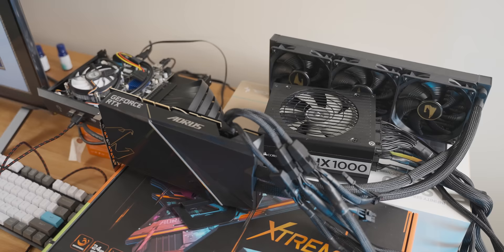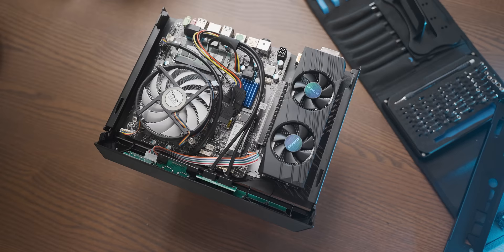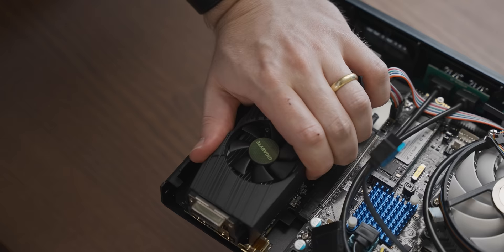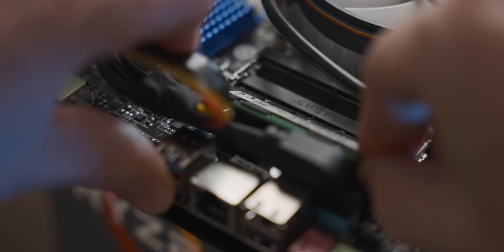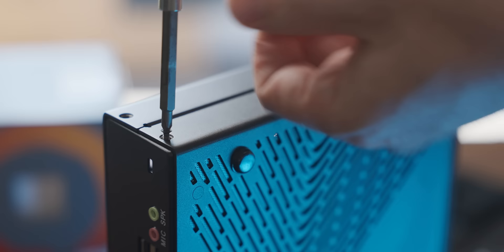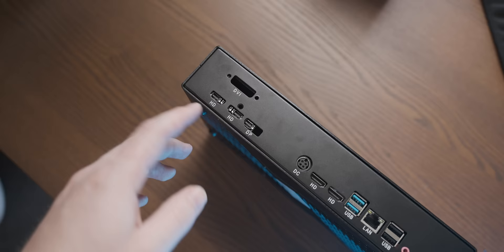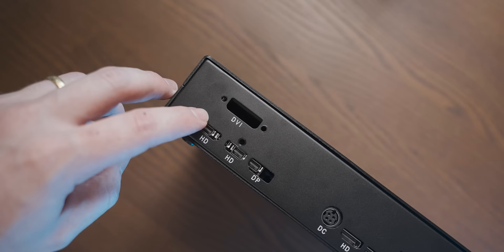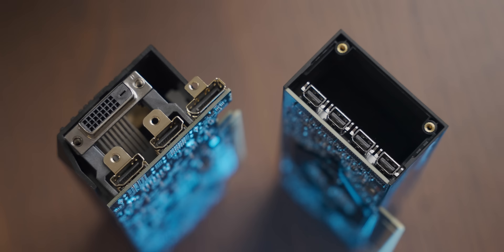Before the super elegant upgrade, I want to get as much performance out of this form factor as possible, and to do that we need to drop an A2000 in here. That upgrade went very smoothly — we even happened to have two of the mini DisplayPorts line up with the previous I/O, and hopefully this little DVI porthole has enough girth to manage 70 watts of exhaust from this blower-style card.